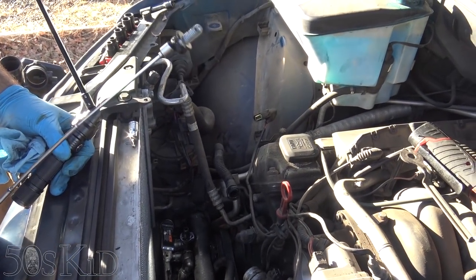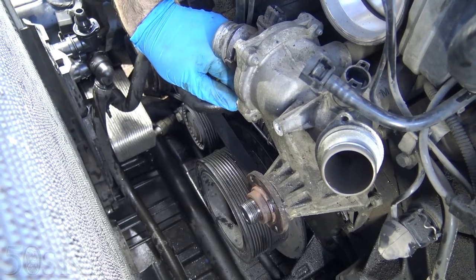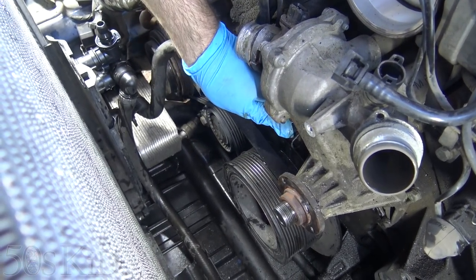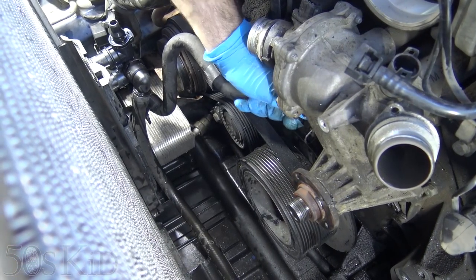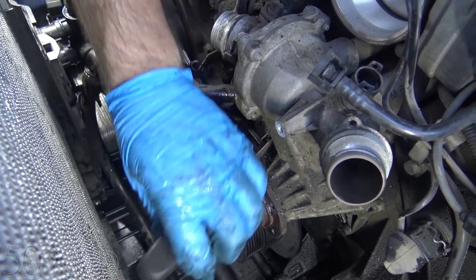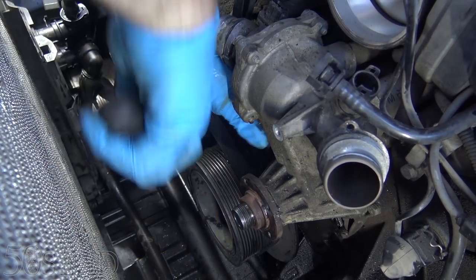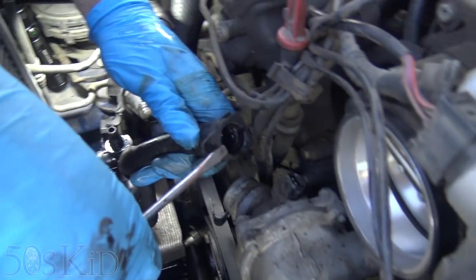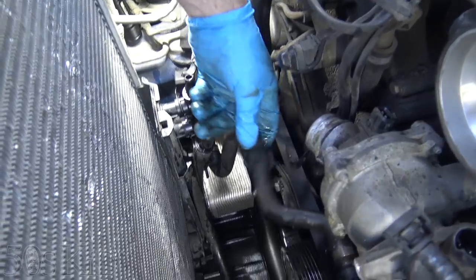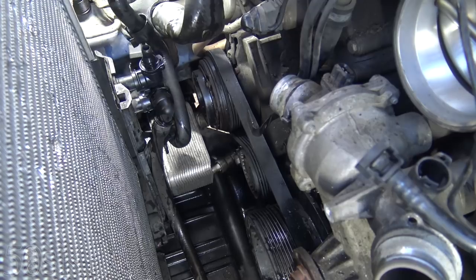This is why you always keep a little magnet in your bag. We're going to take off this lower coolant hose right now and pull out this little clip here — same as on all the others. Hopefully this thing is going to pull off somewhat easily, probably not. I don't think I changed this. Let's try a smaller screwdriver. I stuck my screwdriver down there like this and twisted it — that pried against the metal and pushed it back, and I pulled at the same time. This little clip is going to be sort of in here — you could reach behind with some pliers and push back and that should pop out. This one's already broken, so you can just get this thing loose and pull it off to the side.